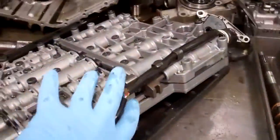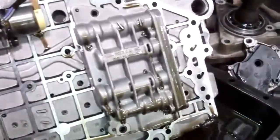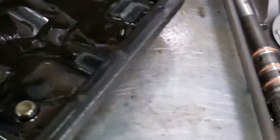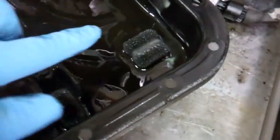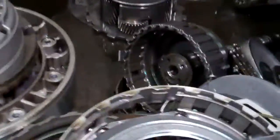There was quite a bit of debris in the pan. This is the valve body — the hydraulic brain of the transmission. I'll show you here in the pan. Audi puts magnets in the pan, and if you can see here, there's quite a bit of metal buildup on the magnet. It's got actually four of them, and there's just a huge amount of metal on there. But there's no place in the transmission that the metal was coming from.